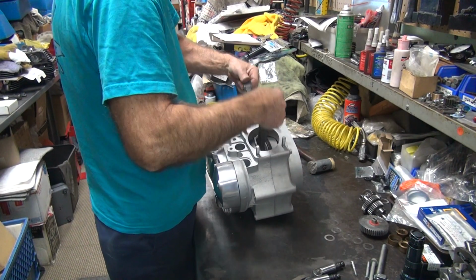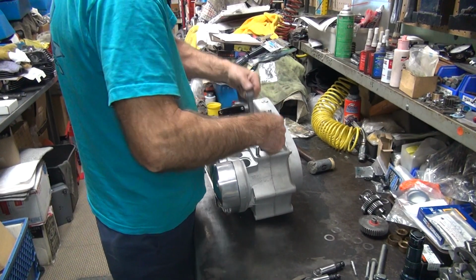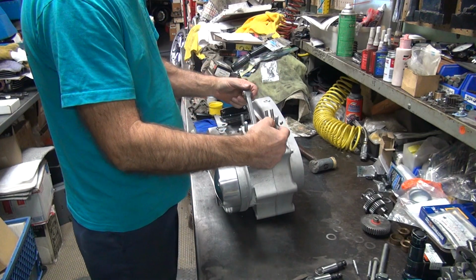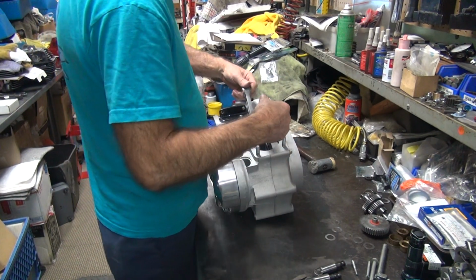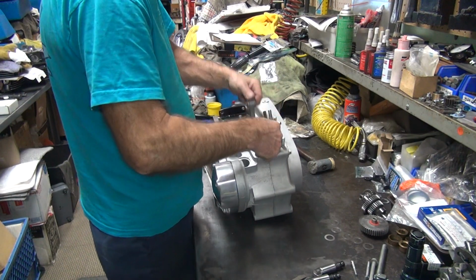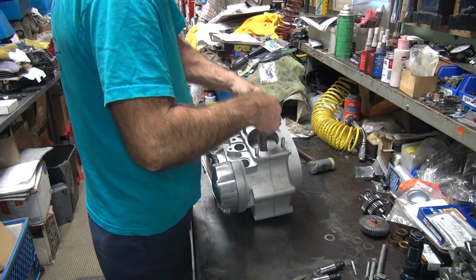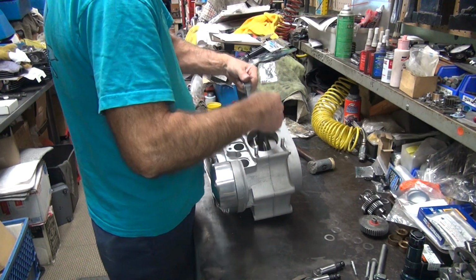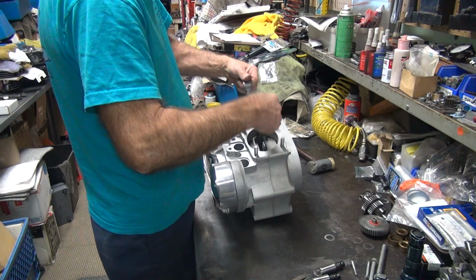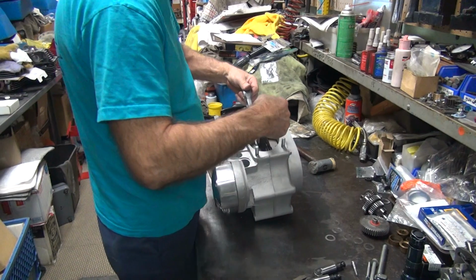How about running a Sportster with a belt drive? I know they made those. Yeah, I got some of that crap laying around. Do they work any better? It tears up your kicker gears real good. The belt? Yep. It runs dry. After you seal everything up, you can't ever seal it anyway. It's impossible to seal everything because it's not made to be sealed. Kicker gear runs dry. Loses the kicker. Well, it all wads up inside the case and makes a big mess.